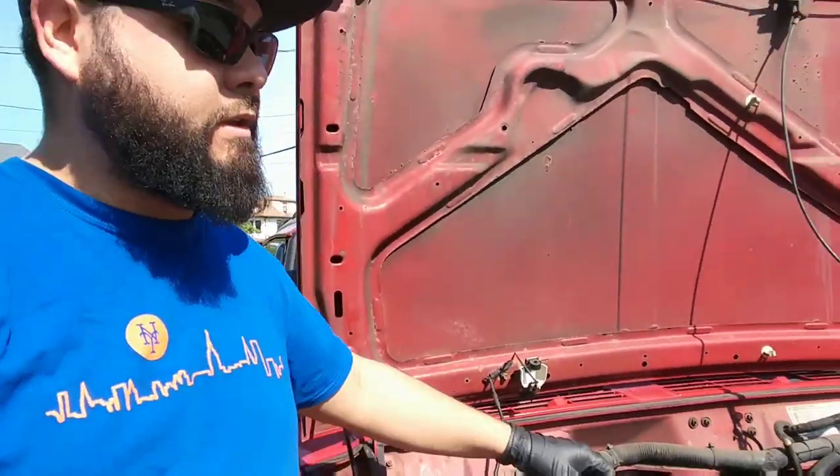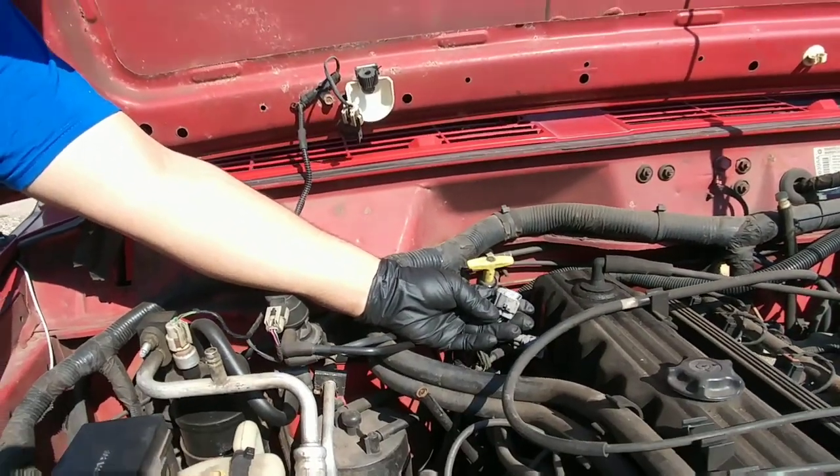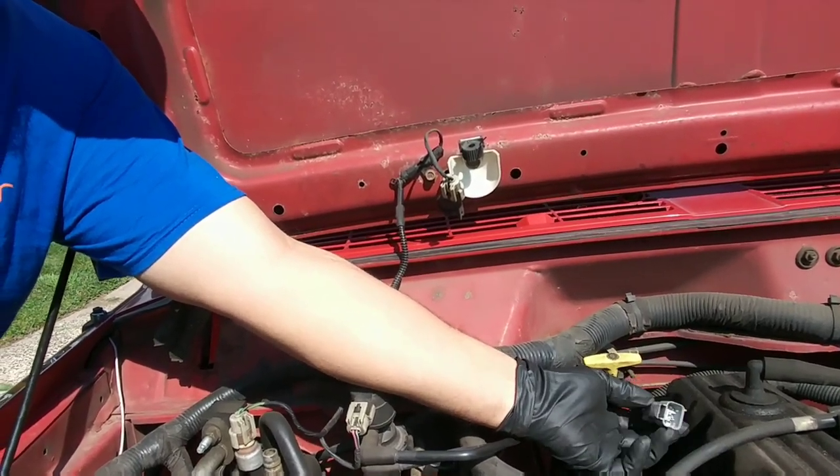I'm doing a little work off camera so you guys don't see me getting frustrated. This is the connector to the body for the neutral safety switch, and this is the actual neutral safety switch connector. There are three zip ties that hold it onto the harness, right onto the body of the transmission. You snip those, go underneath — there's a 12 millimeter bolt which I've already taken out — and a pain-in-the-ass lever retention thing. Seven-eighths is the wrench I used to loosen that one up. The part is legitimately $300 from every source I've looked at.